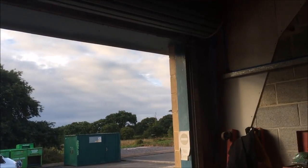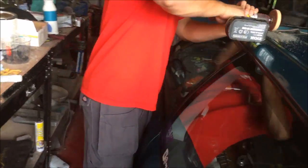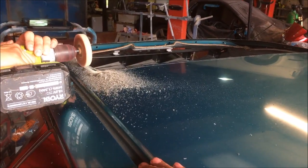So, today we are doing my roof in my special flake, in my custom mix. We're going to get all the sealant off, then sand it with 500, get it nice and smooth, and then literally that is it, and we'll start hitting up the base coat and flaking that. We might be re-clearing my spoiler as well, my carbon fibre duckbill. It's just looking a bit depressed and needing some TLC. I'll be time-lapsing me and Rich stripping this roof. It should be a nice little episode for you guys to see how my roof comes out.